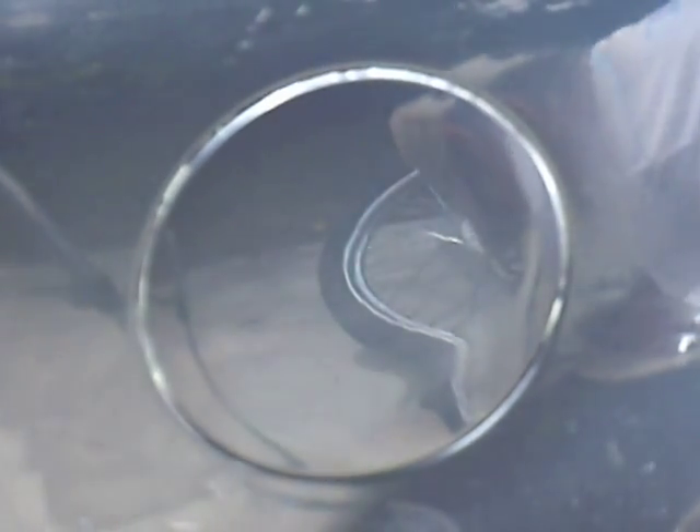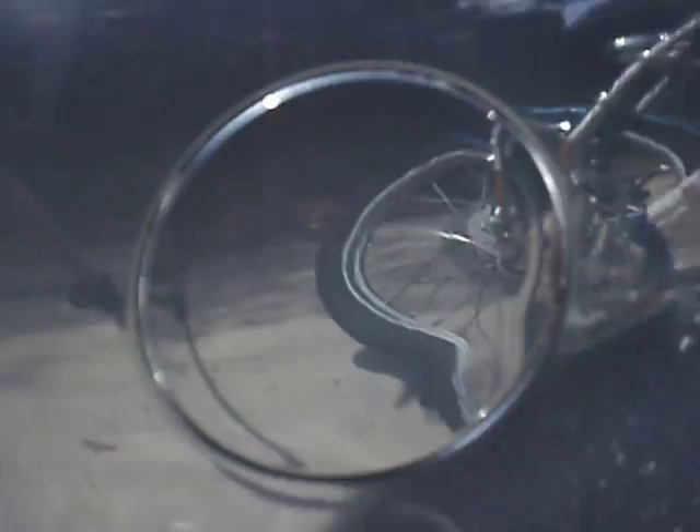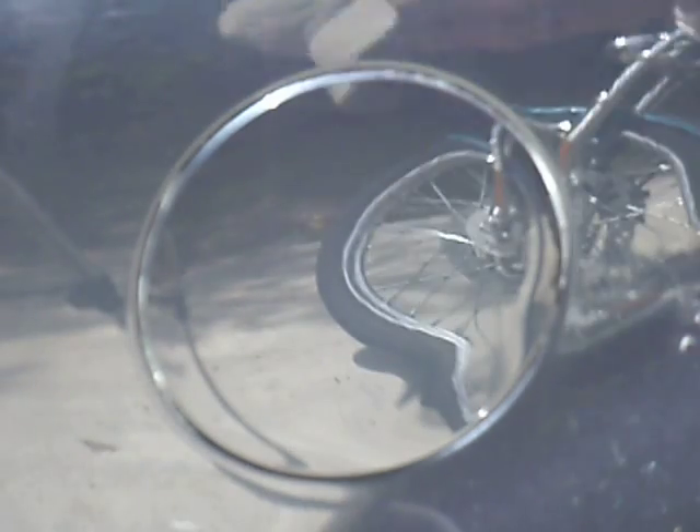I try to center my pads the best I can with my conditions — it's not always easy. Once we polish it out, we're going to swap out pads and put a finishing pad on. We're going to apply the paint protection as the final application. My wheel stays at 1,000 RPM. This puts the sealer on — this is the protection.